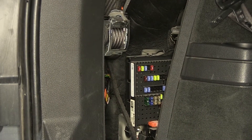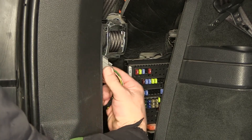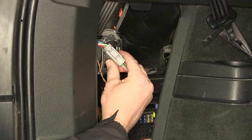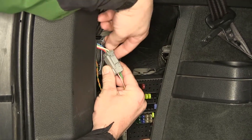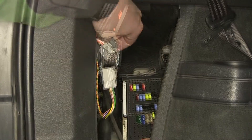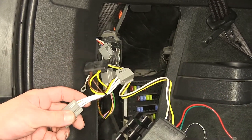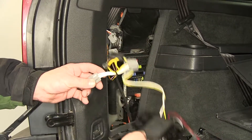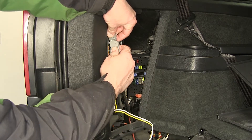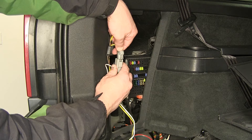With our paneling out of the way, we need to locate the manufacturer's wiring that comes from the back of the tailgate assembly. Reaching in behind the paneling, we'll go ahead and pull it out. You'll see it's a gray connector, and to release it, press on the locking tab and separate the two connection points. Now we've located our connection points, we'll bring in the new wiring harness. Taking the yellow wire connector that comes from the converter box, we can plug in line with the manufacturer's wiring as the connectors will match up. This creates our T connection on the driver's side.